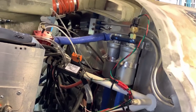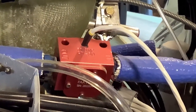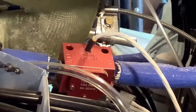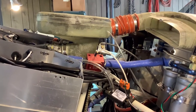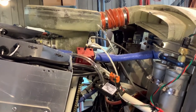These fuel filters then output through one of these red cube fuel measuring gauges — I can't think of the right name for them. There's one there and there's one on the bottom, and the Dynon display reads the difference in flow rate to give you your measured fuel flow.